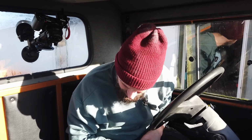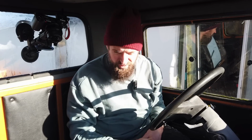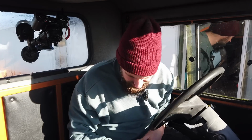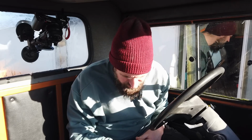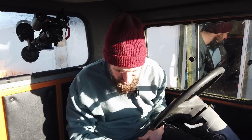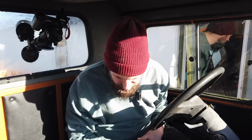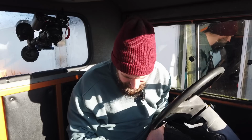It's very decent. So what I want to do is to start the strip down and the removal of the cylinder head. It's a pretty basic engine. It's a push rod engine, so there's not a lot of things to worry about. I have to drain the coolant. I have to remove the coolant hose, the airbox, the exhaust manifold, the carburetor, and the wires, pretty much. That's it. And then, of course, the cylinder head bolts. And then I should be in there. So I'm going to get to work.